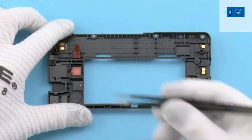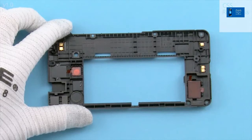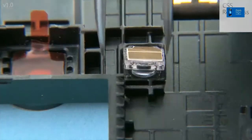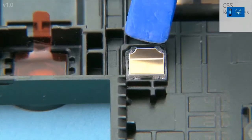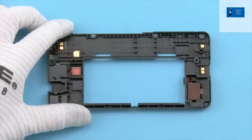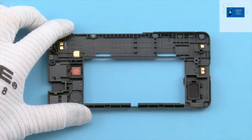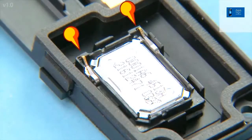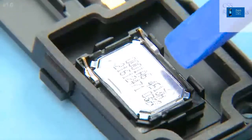Unwrap a new flash LED. Remove the flash adhesive protective film. Place the flash LED with tweezers into place. Align the IHF speaker so that the pins are towards the antenna area. Press with the SS93 to activate the adhesive.